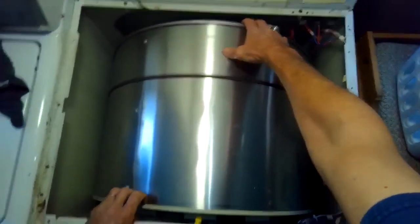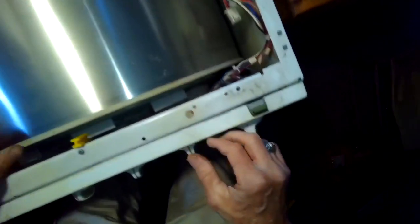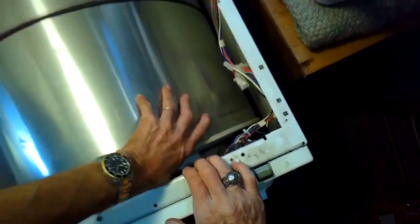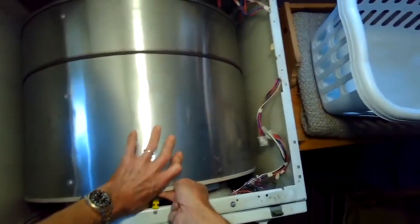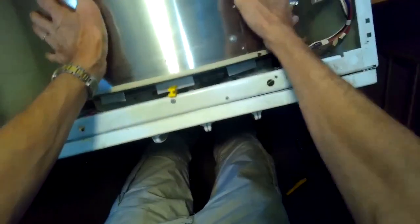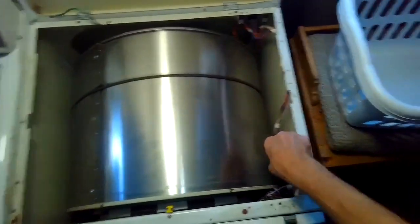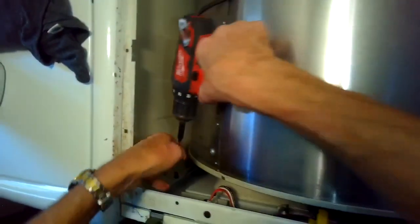Once you've got it, push the front panel all the way in until it clicks. Manually turn the tumbler a little bit to make sure it's really riding on that front bearing well. If the front bearing has slipped toward you a little bit, it's okay — just pull the front panel back off, lift the bearing off, and let the glue dry a little longer before putting it back. This seems good — it's spinning really well with very tight tolerances and no more gap that's going to burn up clothes. Hook the modular connector back in and put a little zip tie on it to hold it in position.